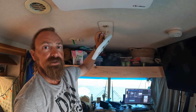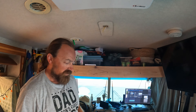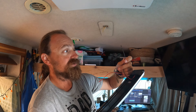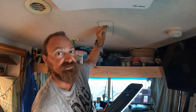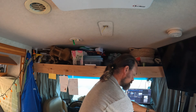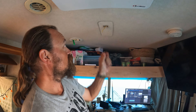Here we have our wires — we're just going to snip them off, like so. The other good thing about this light from Miati is that there is no dedicated power or ground, so you could actually hook the red up to your ground and it would still work, or hook the black up to the ground and it would still work. I always hook red to power, and I know from all the wiring I've done in this Winnebago that the yellow line is the power line. It comes pre-stripped, so that's good. They also give you two wire nuts so you can make your connection. I'm just going to strip these two wires.